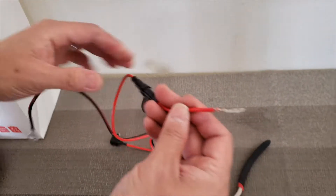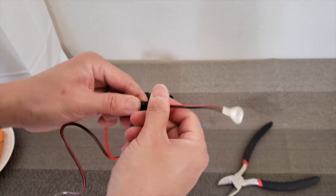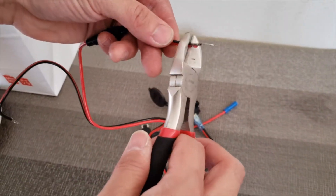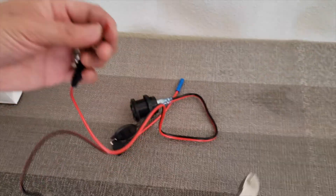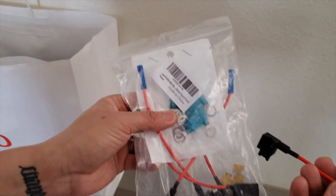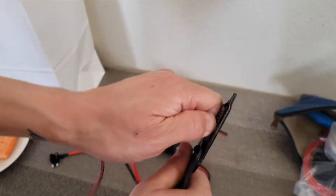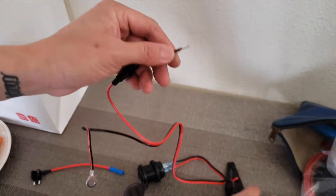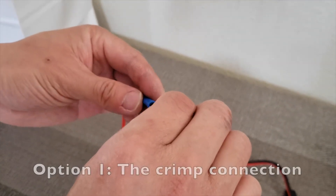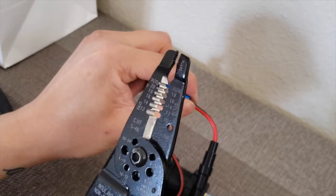Here is the black terminal and this is the red terminal — you can tell because this has the inline fuse attached to it. If you open this up there is an inline fuse right here. I'm gonna take my wire cutter and cut this off. Now we're gonna take some wire stripper and connect this to an add-a-circuit — this is the low profile mini blade add-a-circuit. It's made to crimp, so it goes inside here to make a metal connection, and to secure the connection we'll use the crimping tool on the end of this wire cutter.